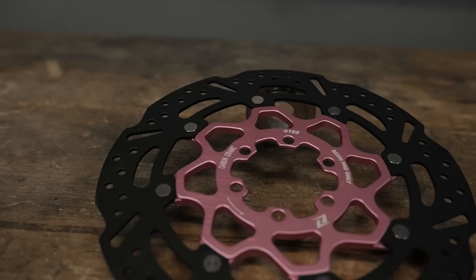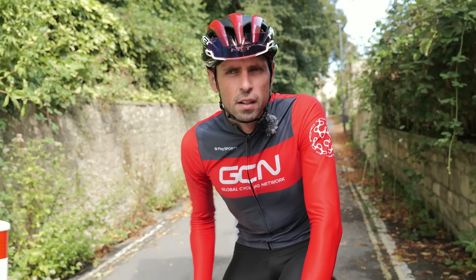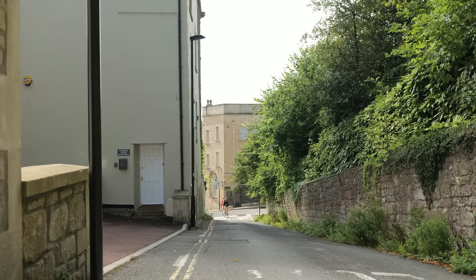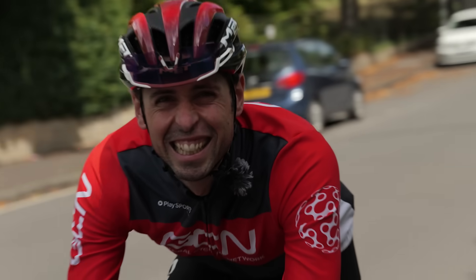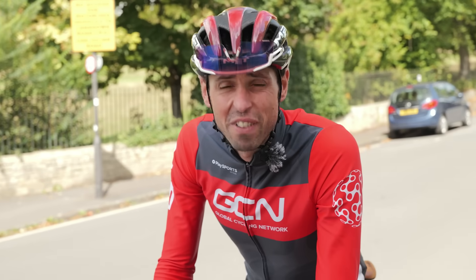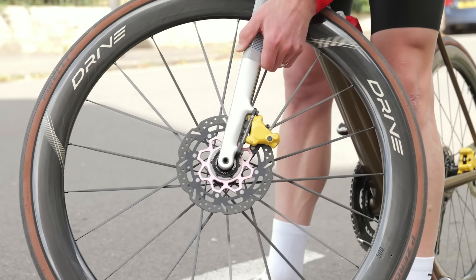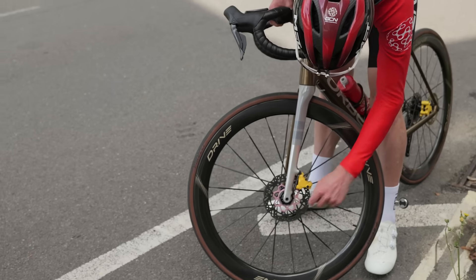Right, to the hill. I've put off doing this for long enough — for reference, this is what the rotor looks like with no braking having been done on it. Let's see what it looks like after one descent. I'm a little bit apprehensive and nervous. Wish me luck. Here goes. Well, it's noisy. I guess you heard me coming before you saw me. First descent done. Very squeaky. Performance pretty damn poor — although in fairness I haven't exactly bedded the brakes in, so we can forgive that. Take a look at this — it's marked up quite a lot. I'm surprised how much marking and scoring there is on the rotor already. It says 'resin pad only' on it, and these are resin pads, so I'm at least trying to be fair to it.